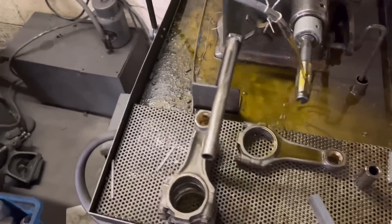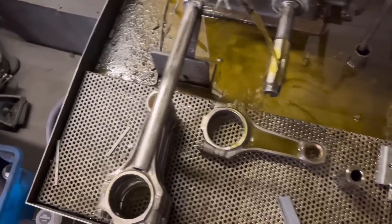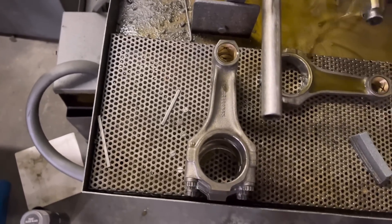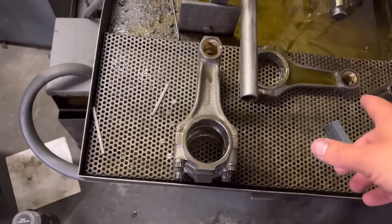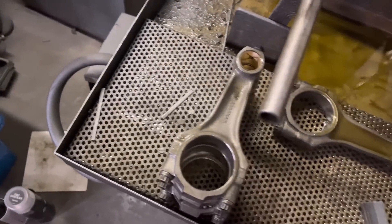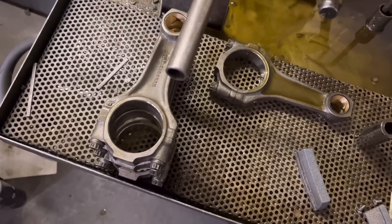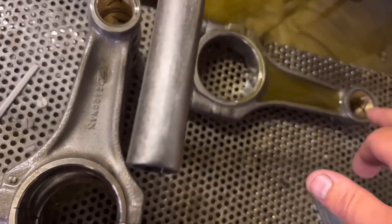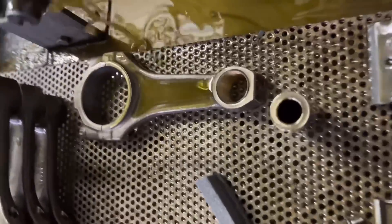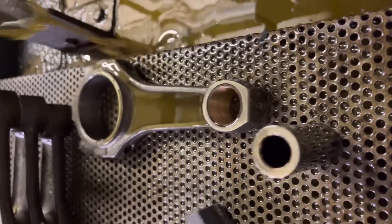Right, so what I'm doing here - I've fitted the small end bushes. These are the ones that Paul Dove pushed out last week, and the new ones have turned up. I'll get these from Burton Power - just as cheap as anywhere else and I know the decent quality. So what you've got to do first of all when you push them in: you've got to make sure that the oil hole at the top there matches the oil hole around the back of the rod.